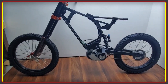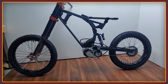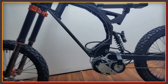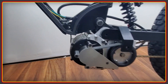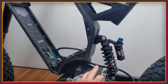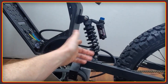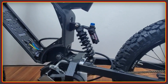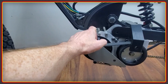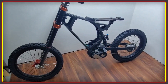The first thing to talk about is the rear shock. I want to change the rear shock point because right now the steering angle is 33 degrees and I want to bring it in a little bit. If you look at the motor, there's a reasonable gap between the motor and the frame, and that's because this whole frame set was designed to use rear hub motors and this is a mid-drive kit. I can't flip the stock bracket around — it's not going to work at the top — so what I'm going to do is basically fabricate something. That will bring the swing arm down a bit, close the gap between the motor and the frame, and in effect bring the steering angle to less than 30 degrees if possible.